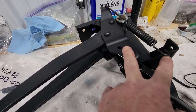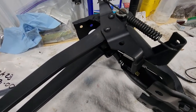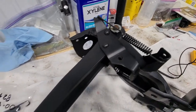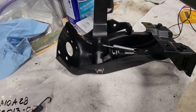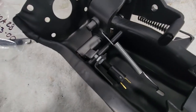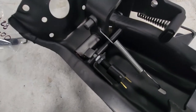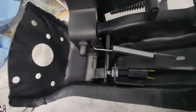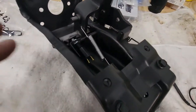For the hydraulic setup, I'm going to measure for a spring to fit up in here — get a nice stout spring, measure the overall length, and then see what I can find for the spring body. This way I get a good upward pull and this over-center spring may or may not even be used. For the brake pedal, the spring I have laying around is five and a quarter inches overall length, two and a half inches on the body, only a half inch in diameter. I really need something more along the lines of one inch diameter or at least three-quarter inch.